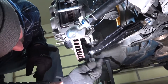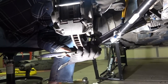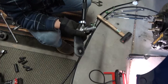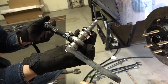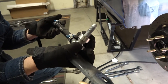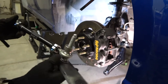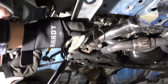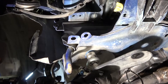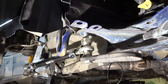That's the nylon nut that goes on after you've tightened the top nut. It gets pretty difficult to turn quickly since it is a lock nut. I believe they're 81 foot pounds, and it's fairly large — I think 24 millimeter. Here's where you assemble the caster arm with that existing plate and the new bolt that goes through it, with your washer assembly. It's got two washers on top towards the frame and one washer on the bottom — the top was a large and small, and the bottom was the smaller washer. I think that bolt was larger than the stock stud nut, maybe a 22 millimeter.